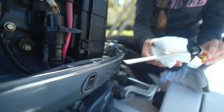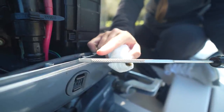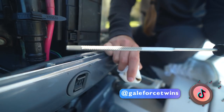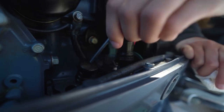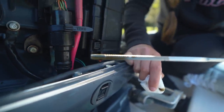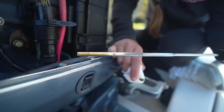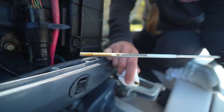We have hash marks on our dipstick, and ideally your oil levels are going to be right between the two — directly in the middle — that's the perfect amount of oil. Put it back in one time, pull it out, and see where it is. We look pretty good, maybe a little low — we might need to add a little bit more. We can also look at the color of our oil; this is close to the color of olive oil, maybe a little darker because we've been running the engine.